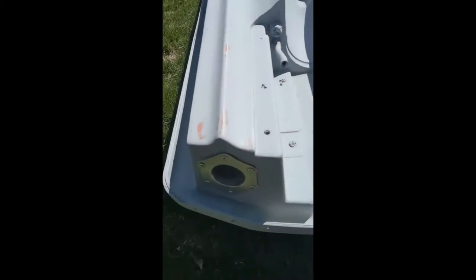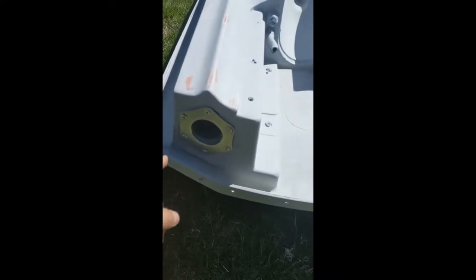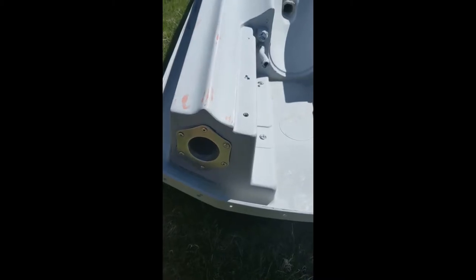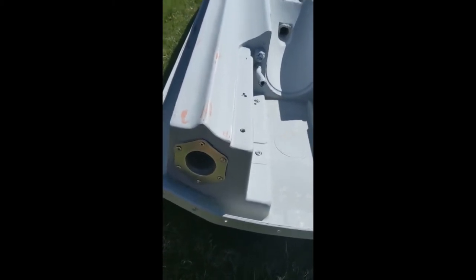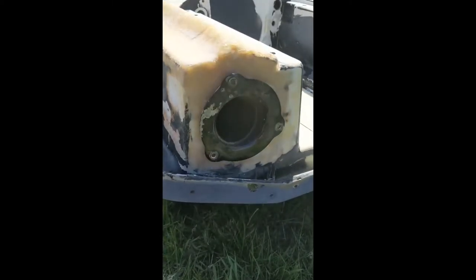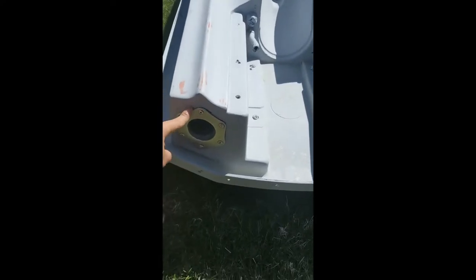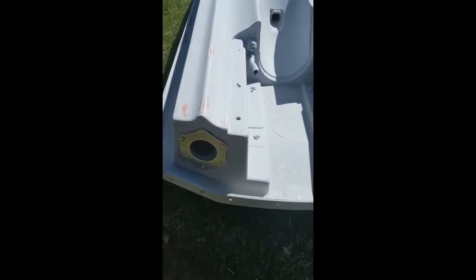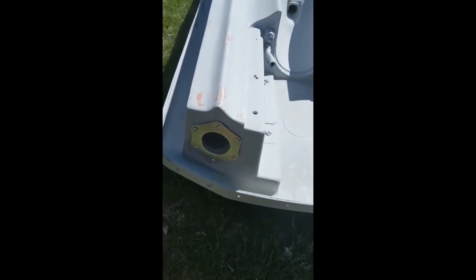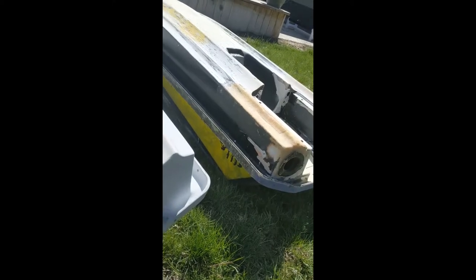There is one difference, and that is the exhaust. This one I've already replaced. This is now a 2.5 inch, whereas the stock is below 2 inch. I forgot the number exactly, but that is one difference between the round nose stock and the square nose. You can get these from, this one I got from Rad Dudes, and that'll pretty much make it the same as a Superjet.